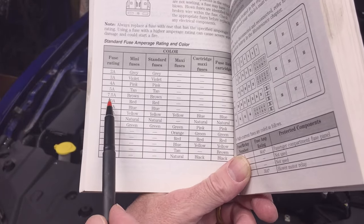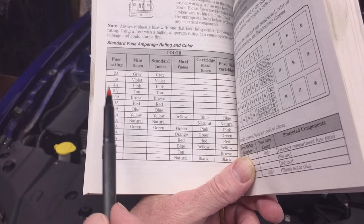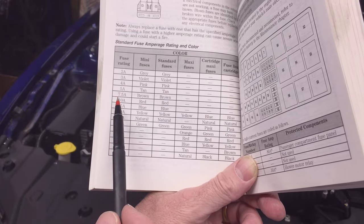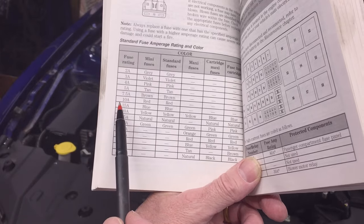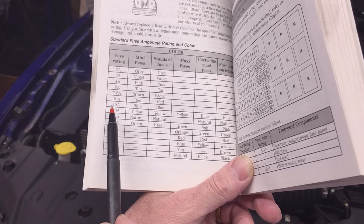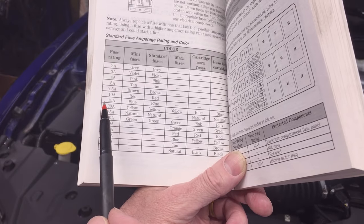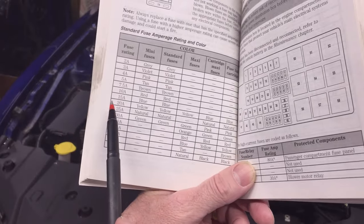The color applies to a different amperage. When you change fuses, you want to maintain the same fuse that came OEM — stock with your vehicle. You don't want to put a larger fuse in, as that could potentially cause wire or component damage and possibly a fire. If you do have to temporarily change a fuse, go back and buy the correct fuse and replace it as soon as possible.